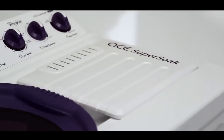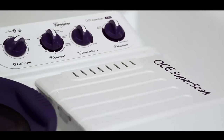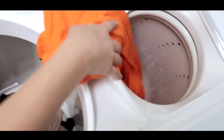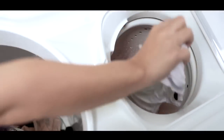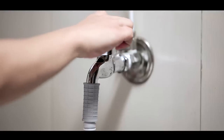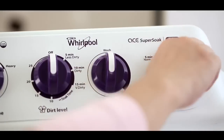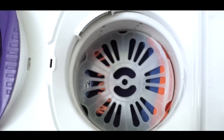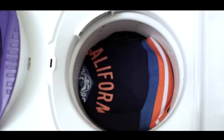Spin tub rinsing. In the Whirlpool Ace Super Soak washing machine you always have an alternate option for rinsing clothes in the spin tub. After draining detergent water from the wash tub, move clothes to the spin tub. Set the water selector to spin and open the water tap for 4 to 5 minutes. Then set the spin timer to 5 to 10 minutes according to the load. The spin shower ensures a better rinse and effectively removes detergent from clothes. We recommend that before moving clothes to the spin tub, one round of rinsing is done in the wash tub.